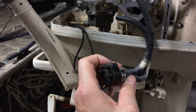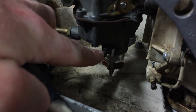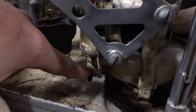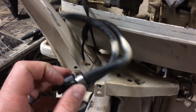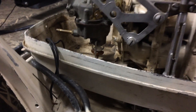This is the old dual line gas connection — it has two lines. One runs to the carburetor at this junction, and the other runs to this nipple, which pressurizes one of the lines. That line goes to the gas tank, pressurizes it, and pumps fuel up through the second line into the carburetor, keeping the carburetor primed and the engine running.